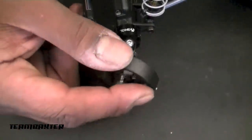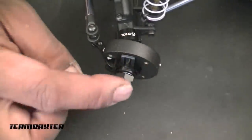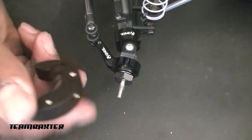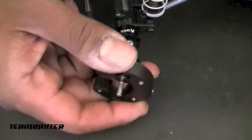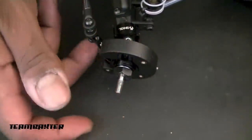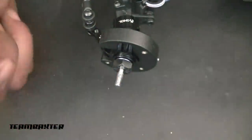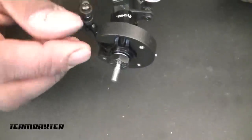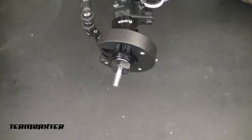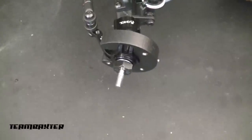Here's my knuckle and here's the knuckle weight — it just slides over the knuckle and the set screw screws in and locks it where you need it. I need to make sure the set screw is on the outside so it'll catch the knuckle. I don't like that it will scratch my aluminum knuckle up a little bit, but that's the price of having it installed. You need to make sure you get it in far enough so it doesn't rub the inside of your rim while it's spinning.